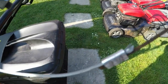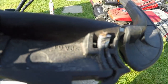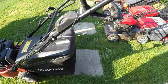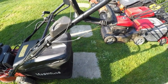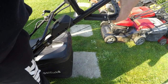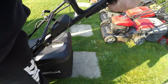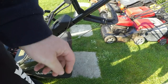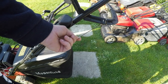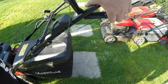And by using these little tiny clips, which you squeeze on, you're able to actually repair the cable instead of purchasing all new cables, which are £15 to £20 each, and that now works probably better if not as good as when originally manufactured. So that all now is up and working, so that saved a few quid, and they're about £6 for about 50. You just put them through, make sure you get the right size, crimp them together, and it's a really good repair.